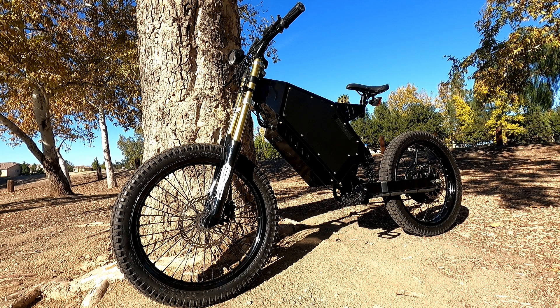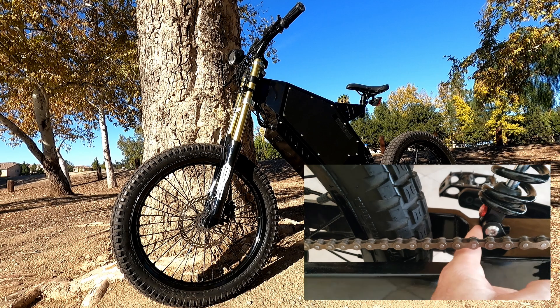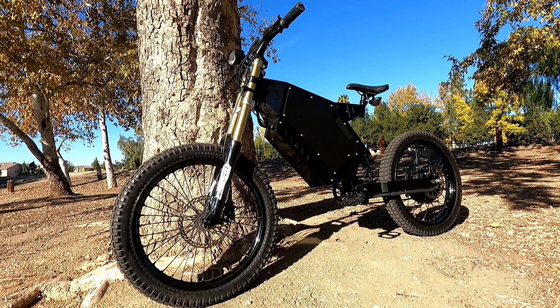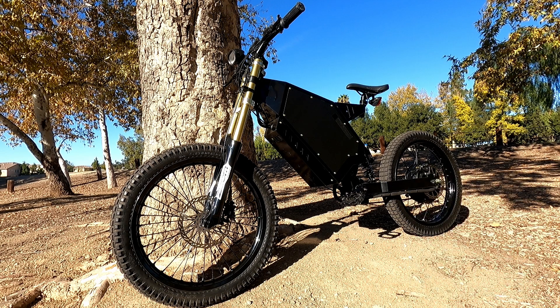During my review video of this bike — I'll put a link in the description — I mentioned that I had my rear shock adjusted too soft. Basically I went off-road, hammered it, jumped it, and ended up bending the shock mount and cracking the swing arm. I straightened the shock mount out as best I could and had a bead welded across the crack. I was going to reinforce it or replace the shock mount, but when you make one area stronger the next weakest link fails. I think if I want to ride like that, I probably need to change the shock — maybe going from 190mm to 210mm spring for more travel, and upping the spring rate another 100 pounds to make it stiffer. For now I'll just take it easy.